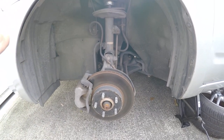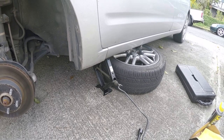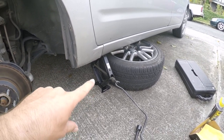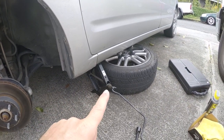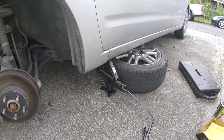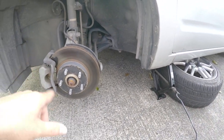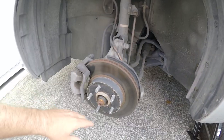The wheel is off. No matter how nice your wheel is, it's worth putting it under the car. If that jack fails or falls over, you don't want the car crushing you. I always put my wheel underneath just in case for safety. Jack stands would obviously be best, but I don't have any at the moment.